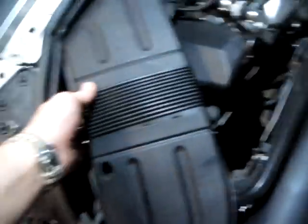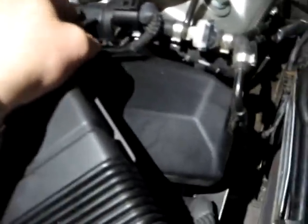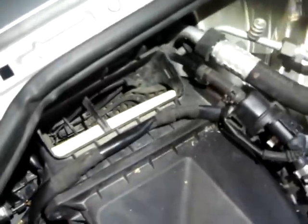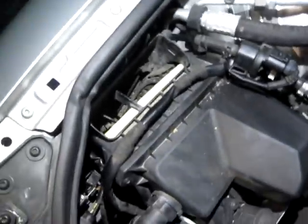Okay, first thing to do is to uncouple the air intake. Just easy, whip that out. Then it unclips up here from the sensor cable. There we go. Then carefully pull it out here. There's your air intake. I cleaned this up the other day, but it never hurts to take this assembly apart and get the crud out there, because it's usually full of crud.